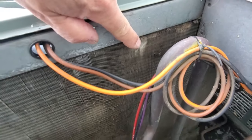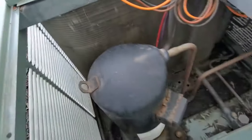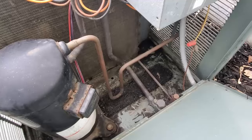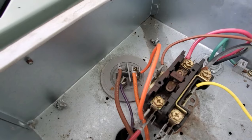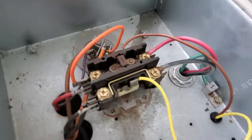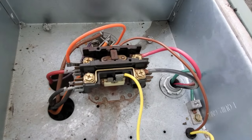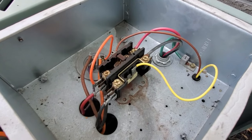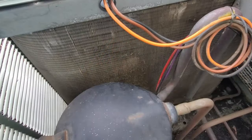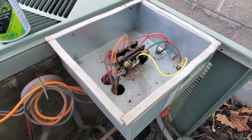Here's a part where it got smashed in — I'll try to straighten those with the brush later. This was caked all the way down and you can still see some dirt near the bottom. Here's the compressor, all the lines where the freon flows through, power connectors, and here we have a capacitor — brown wire, two orange wires, and a purple wire. That's the contactor, basically a power block. I'm replacing both since this hasn't been serviced in 22 years. Parts are arriving later today.